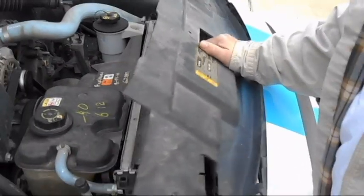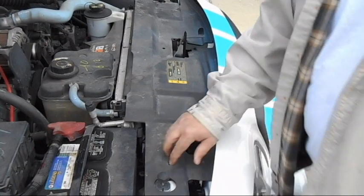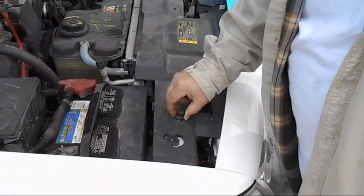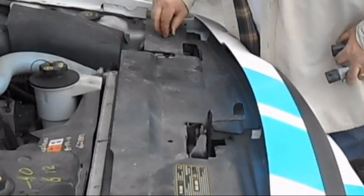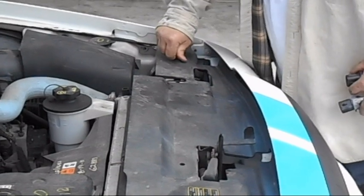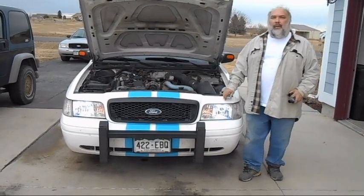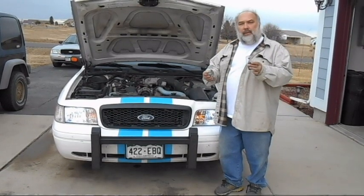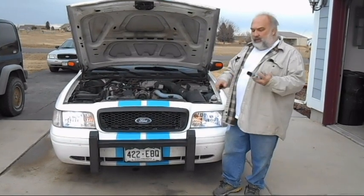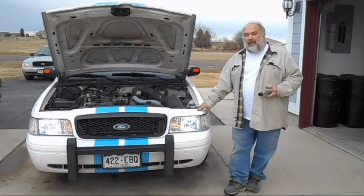Then what you're going to do is put your plastic piece back in. Go around, make sure it's actually in, make sure this little leg right here is back down where it needs to be. Then put those little knobs back in to tie it down. Now we've actually installed our brand new lights — they're clear, they should be brighter. I've never used these xenon lights before, so I'm going to keep the spare light bulbs in the car just in case one of these xenon lights goes out. But other than that, that's basically how you install a brand new set of lenses and light bulbs. Thanks for watching.